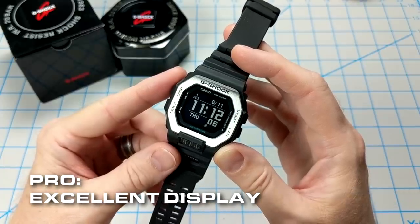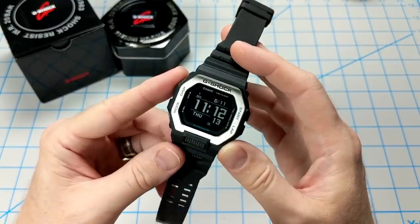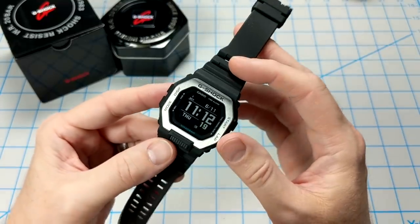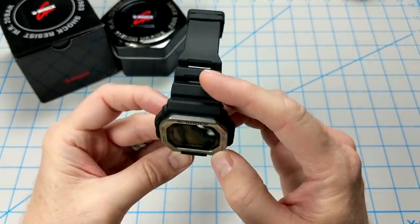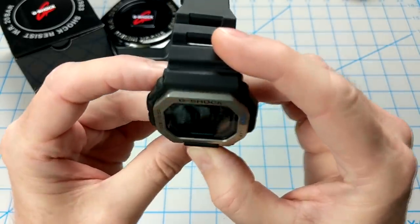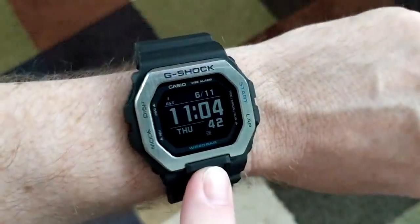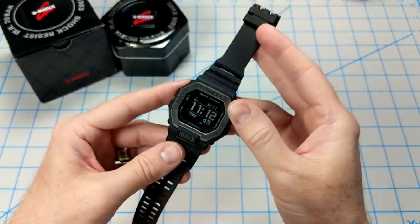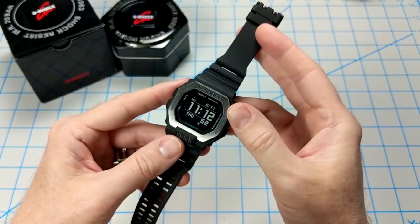The next pro is that the display is great. It's perfect in both bright sunlight and in darkened rooms, and this is actually probably the first negative display watch that I can actually read in a darker room. It's highly reflective, so out in the sunlight it's perfectly legible, and the viewing angles are great. On some LCD watches the numbers kind of disappear when you tilt them, but this one has excellent viewing angles. The two LED backlights are very strong and bright — here's a shot of the backlight in a darkened room, really bright. It illuminates the entire face evenly, and overall I'm really impressed with the way this memory-in-pixel display came out. Pretty high quality.